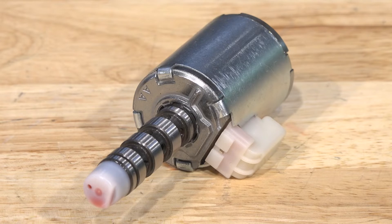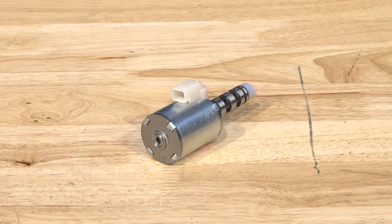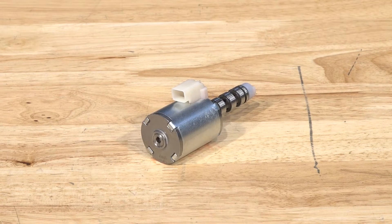What could possibly happen to the vehicle if these signs go unnoticed or unresolved? If left unattended over time, this could definitely lead towards transmission failure. So what makes this solenoid an upgrade from the factory? The factory solenoid works okay under normal driving conditions and stock horsepower, but what makes the XD306 an upgrade is that it can supply more fluid faster to the direct drive clutch to get a firmer, crisper shift.